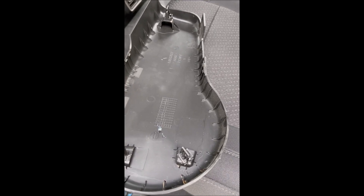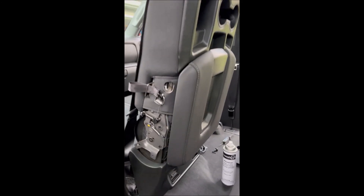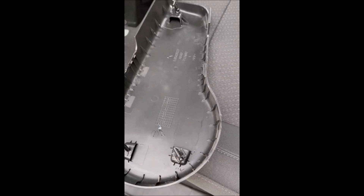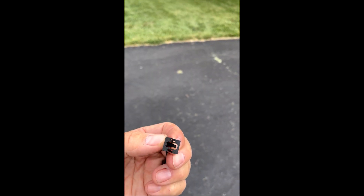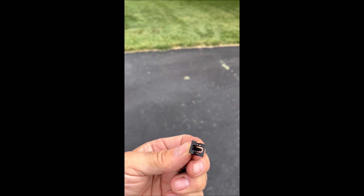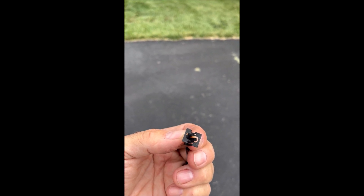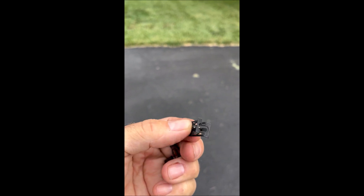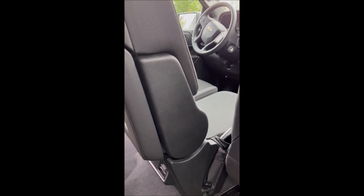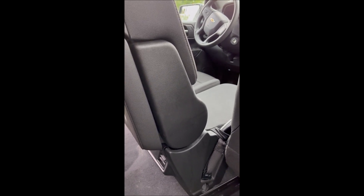One thing to mention: the new replacement does not include clips, so you have to take the clips off the old top. There are slots in here that contain — I think two on the left side and three on the right — so just put them back on the plastic before you snap it in. For these clips that hold the plastic bezels, there are two inner tabs that you squeeze together to pull the clip out of the original console top. Don't pull on the outside tabs — it won't come out; you have to squeeze those two inside tabs. The right-side plastic bezel then snaps right into place — put the clips on first before fighting it.